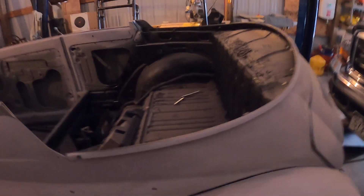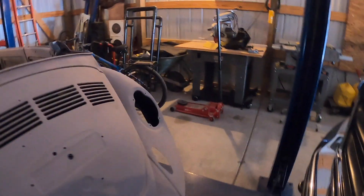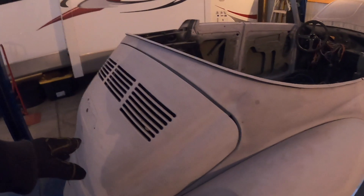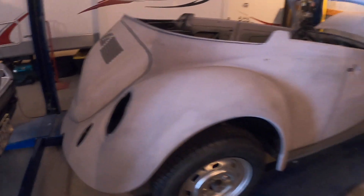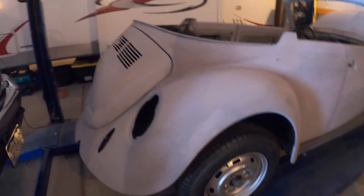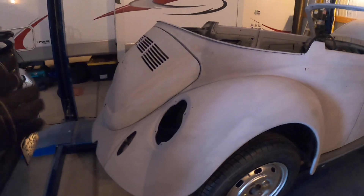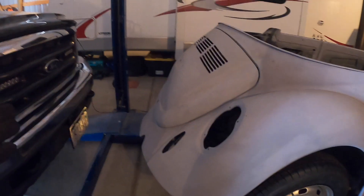Three batteries up front, and then there's going to be three in the rear. The battery box in the rear is going to bolt right in here and be flush mount, with a little increase in angle. The motor goes in the rear — it's going to be a Hyper 9 motor, which is a permanent magnet motor. 120 horsepower and 200 foot-pounds of torque from 1 RPM. Most gas engines, most diesels, you have like 200 foot-pounds at 2,000 RPM. An electric motor, this is going to be 200 foot-pounds at 1 RPM all the way up through — I think it spools at about 8,000 RPM.